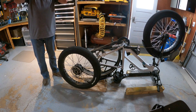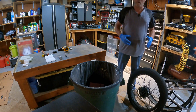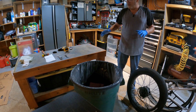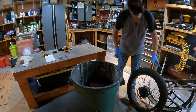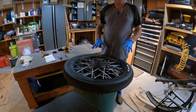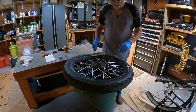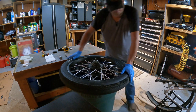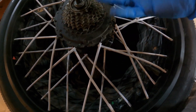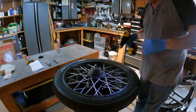Now we're going to set up our workbench and show you how to get the actual motor out. In order to get the motor out, we want a good flat workbench surface - this works great and you don't have to worry about the shaft wobbling the tire. At this point we need to remove these six screws and it should lift the motor right out. We'll do that with our T20 torx bit.